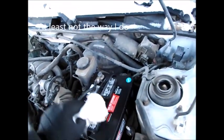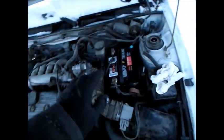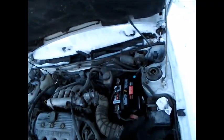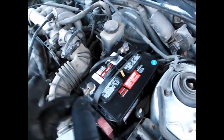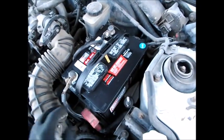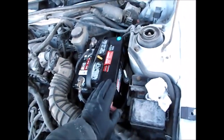Now the battery is something that I am somewhat of an expert at. As long as that battery's got a little bit of charge — the battery's good, meaning it's still charged and it'd probably start the car — but it wouldn't do that for long. After sitting for about three months, that battery would be stone dead. You see, batteries, especially lead-acid batteries, they discharge on their own. The plates are just separated by paper and fiberglass, so the electrolyte can actually diffuse ions between the plates and the battery will discharge. Car batteries are really good, but they still lose about 1% of their charge per day, so after about a hundred days they're going to be completely dead.